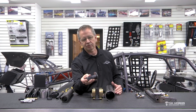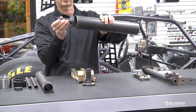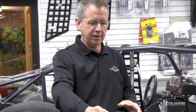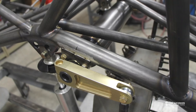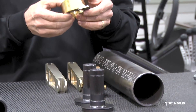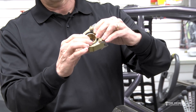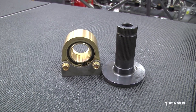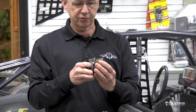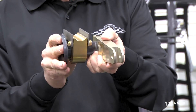This is made out of the same material as their axles, and it's got a really nice spline on it. These are going to press fit into this tube — that's going to be squared up — and then weld around this circumference here. This kit is variable; it comes with this length of tube and we have longer lengths available, so if you have a really wide spacing in the back you'll need to get extra tubing. The chassis mount has aluminum spherical bearings — a spherical center ball with a Delrin race around the outside, so they're real tight and nice — and a little spline that locks on the spline on the shaft.